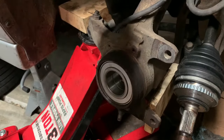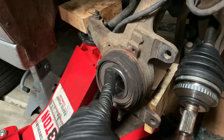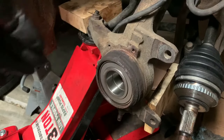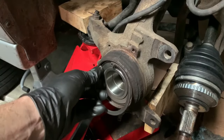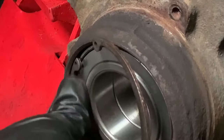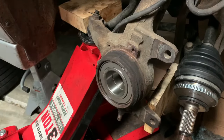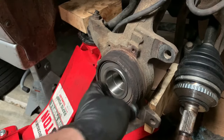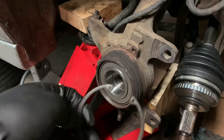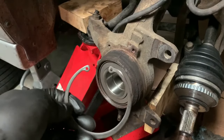When you think you have it, you have to look back behind and see if there's a 16th or 32nd of an inch gap between the wheel bearing and that cavity that we scraped out with the pick. If you think it's close enough and you go to put your snap ring in and it does that — it doesn't do that. It's not in far enough. Just give it one or two more cranks. Slow and steady wins this race — you don't want to bottom this out too much and damage it. Now put the snap ring back in.